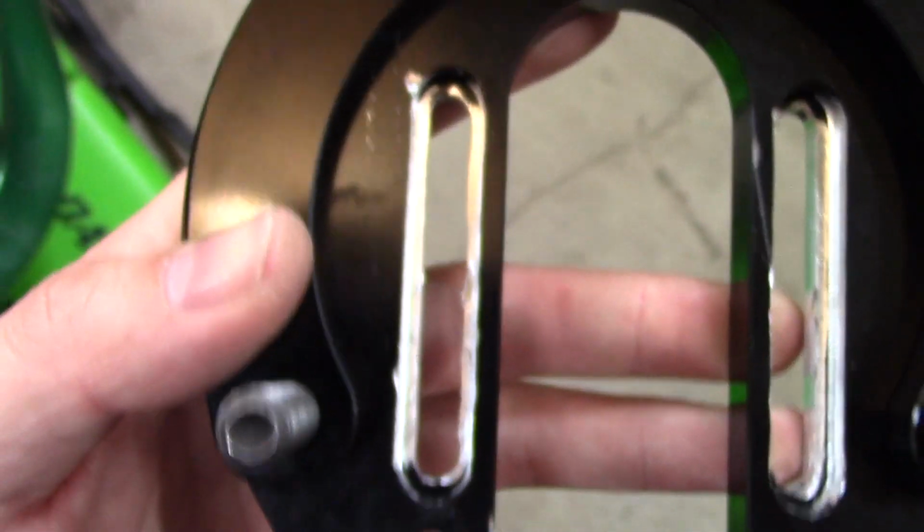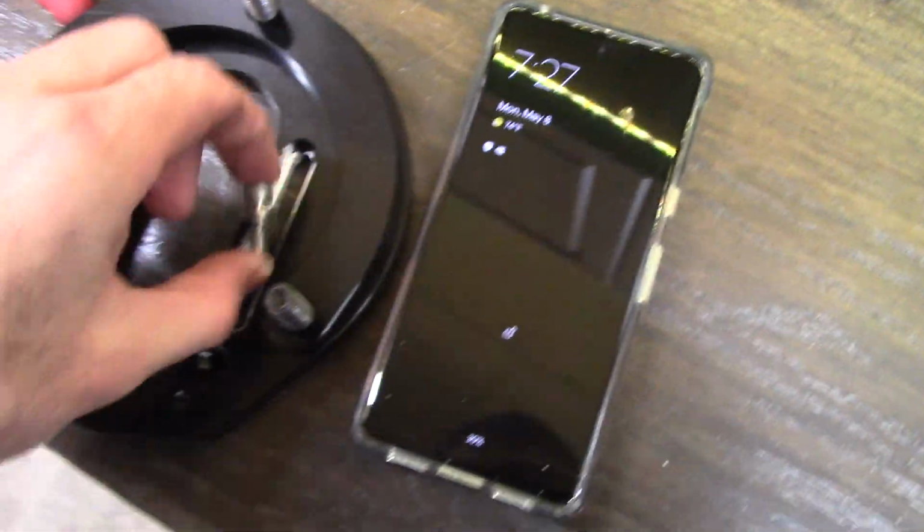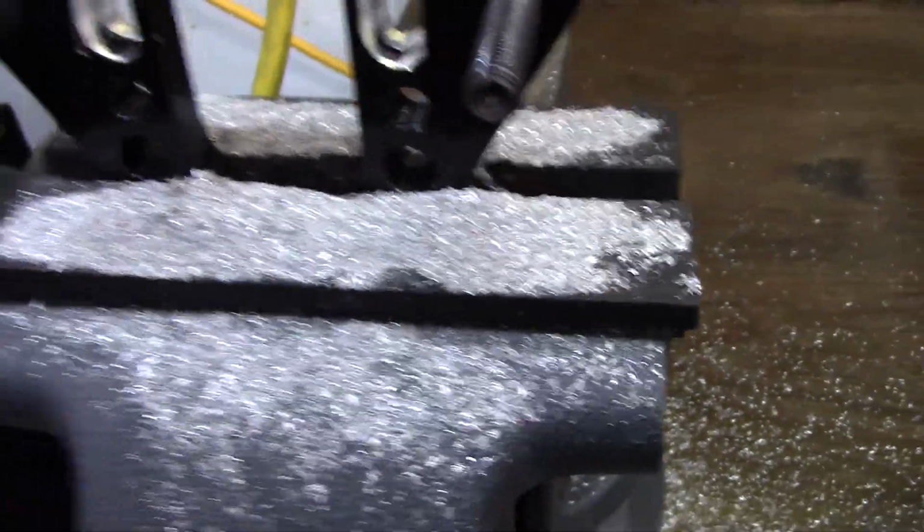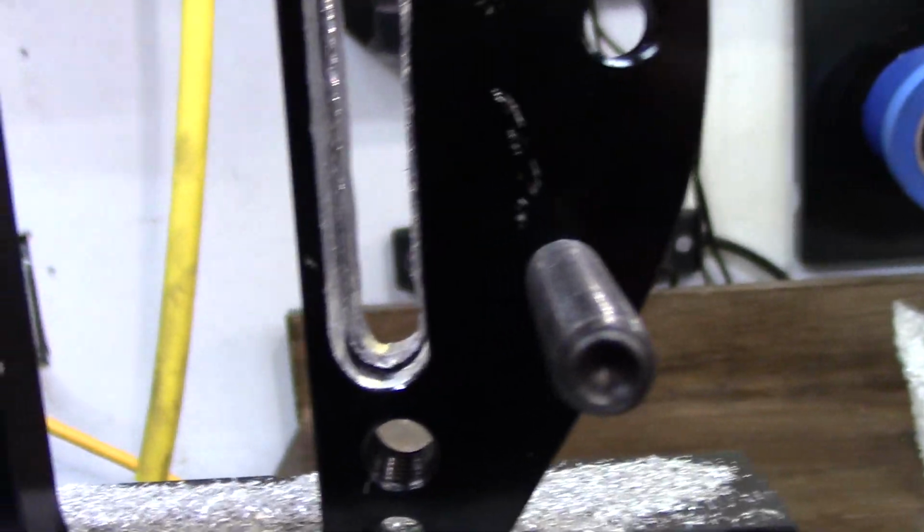The only problem was, you can see all these grind marks. The Allen bolts that go through and bolt into the top of the coilover were not able to line up, so I had to open them up. And look at the amount of freaking metal dust. I think it's billet aluminum, but man, I ground these slots out a lot. I hate doing that. I mean, these top hats were like $200, but we gotta do what we gotta do to fix our camber problem.